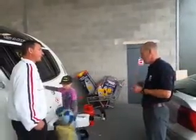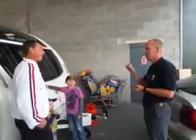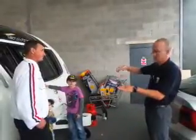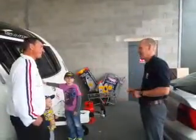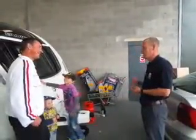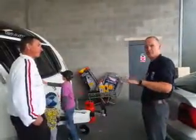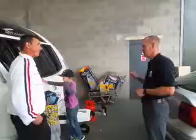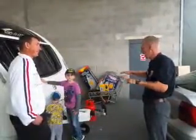The reason why we level the caravan is: one, the drains - if the sink drain is on one side and it's tilted that way, the water's just going to sit in the sink rather than going out the plughole. The other thing is the fridge, which when on gas doesn't like to be on an angle, so that's the other reason why you need to get it leveled.